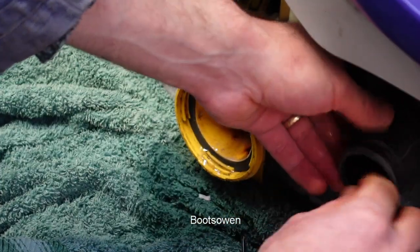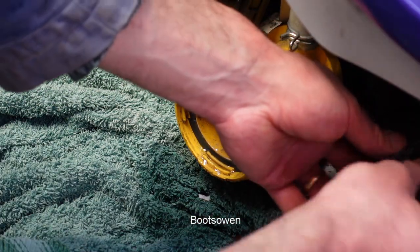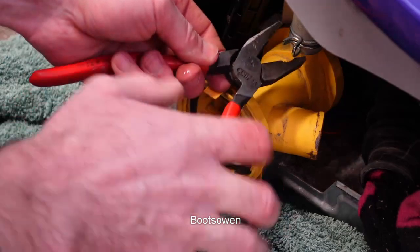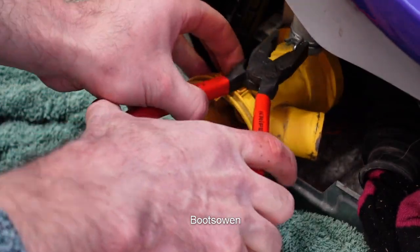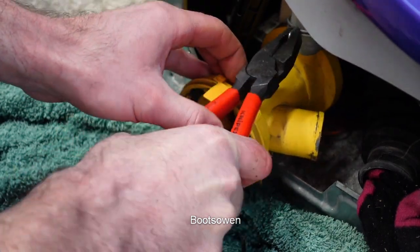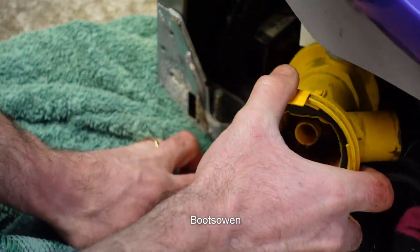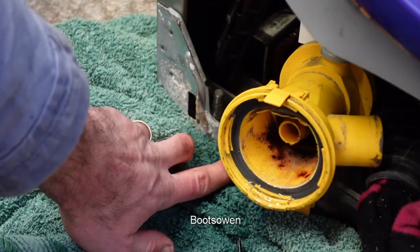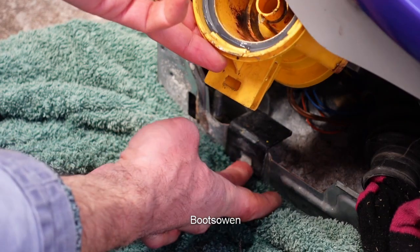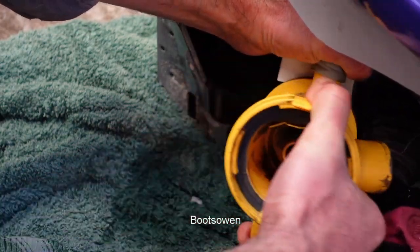There were a couple of screws in here when I cleaned the pump or the coin trap previously. I'll put a sock in there to just hold it out of the way. I'm going to need pliers on this clip here. This is the outlet hose. Just grip it and wiggle it and lift it up if it'll move. Now there should be a little metal tab down here. There's a little metal tab and I've pushed that in to be able to free this up.